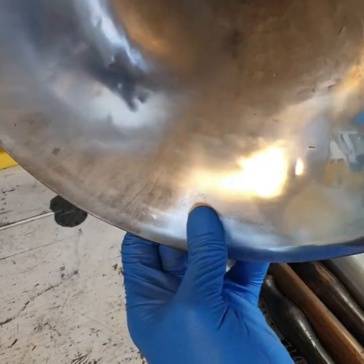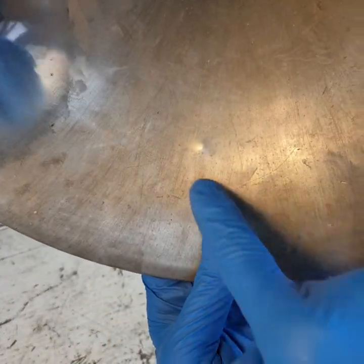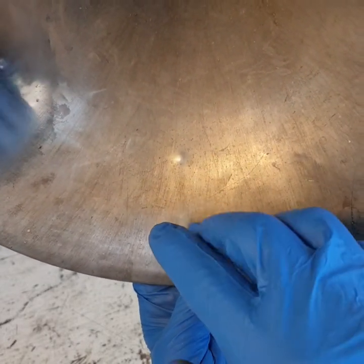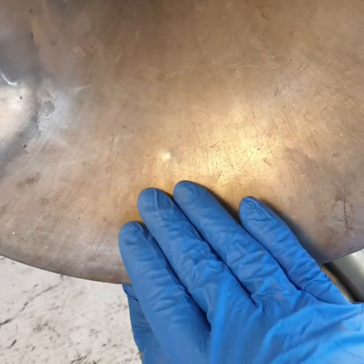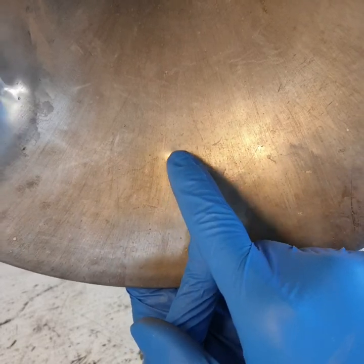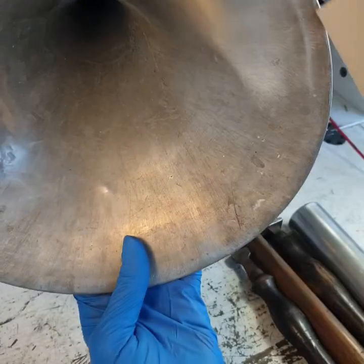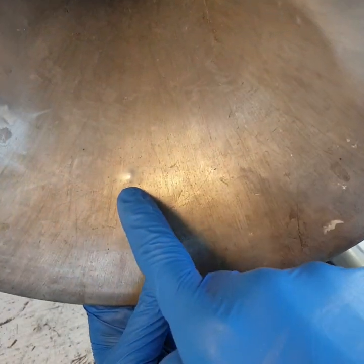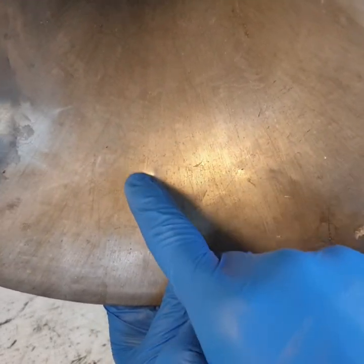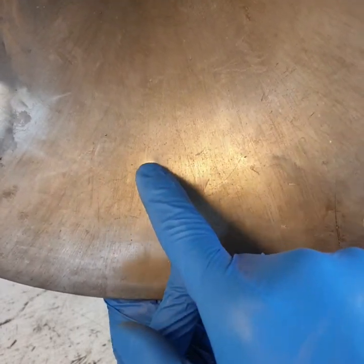Why? Because if I choose, for example, this ding here, okay, and I start sanding it to see if it can be smooth, I use three kinds of grits of sanding pads, the sanding paper or pads will sand much more this part here than the surrounding. So it will make the aluminium much thinner here, or I can even make a hole here.